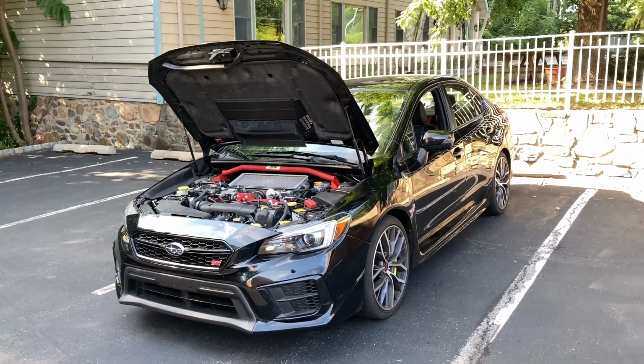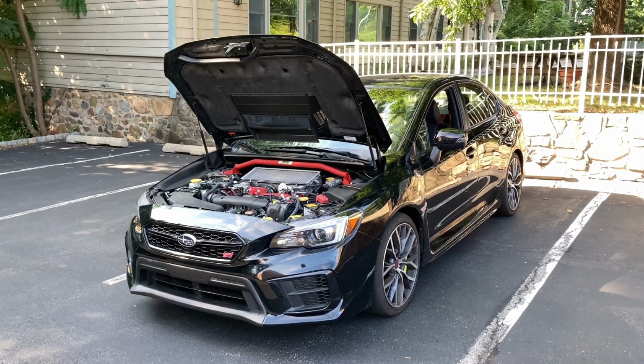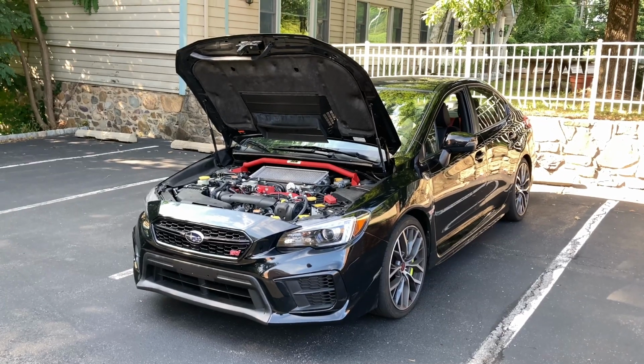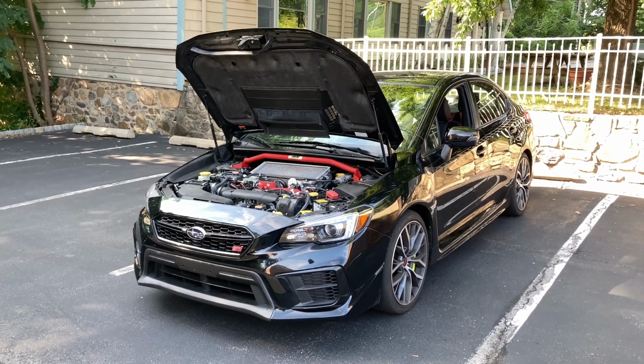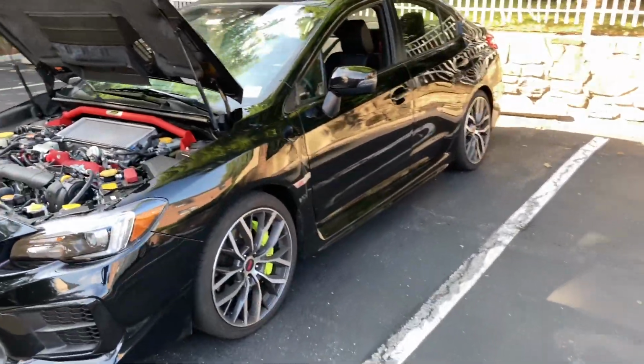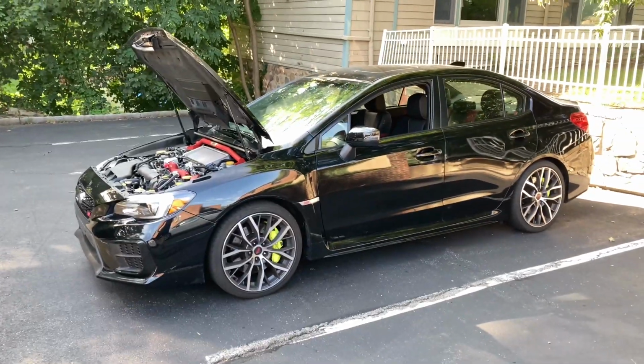It leaned a lot less around turns, to the point where the back felt kind of loose. Now the front was really tight, back felt loose. So what I had to actually do is get a thicker rear sway bar to counteract that, and the car feels great right now. It's on stock suspension, stock shocks and springs, stock ride height here, that 4x4 look right there.